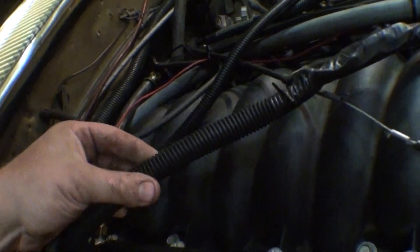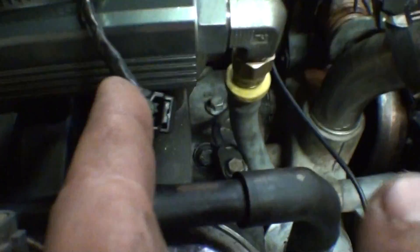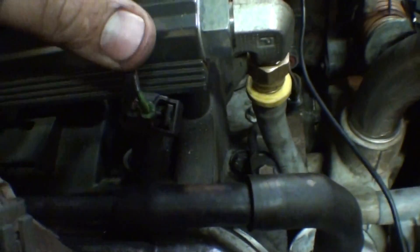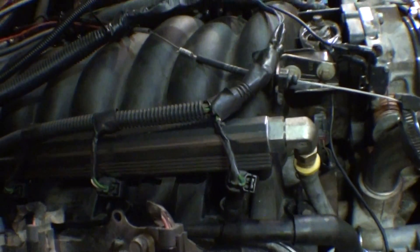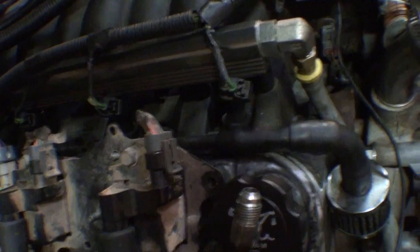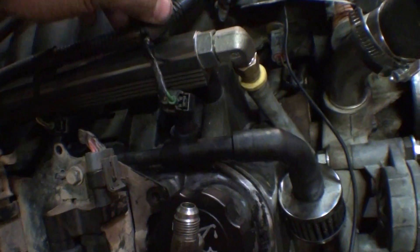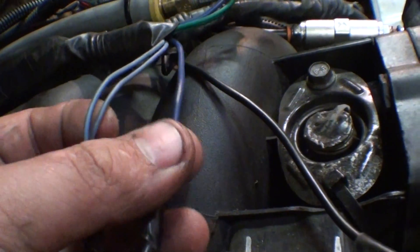You would run them out, and here's my Megasquirt harness. Basically in here this mostly runs all the injectors — there are big power wires loomed in. On GMs mostly, if you use GM or other connectors, there's going to be pink and green, pink and blue, pink and whatever. These are off a Volvo, so there's a common green, some orange and white, green and yellow and white, green and purple and white. I find it easiest — you can do this either way because the injector is basically a solenoid, you can power or ground either side. I take the common color and make it power. You connect them all together, crimp into a big connector, and that's the power wire from the car giving the injectors power.